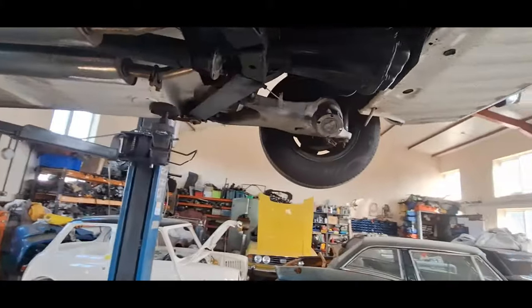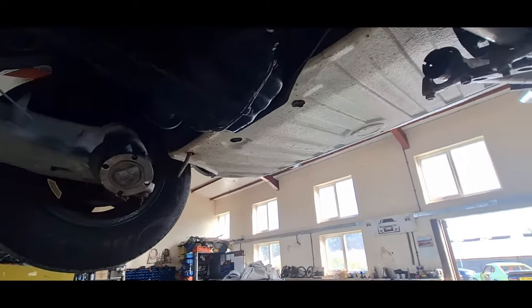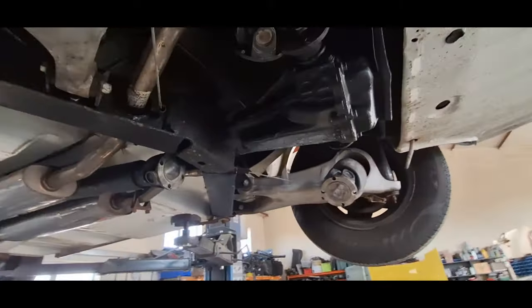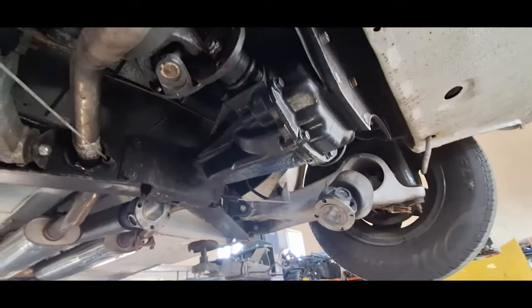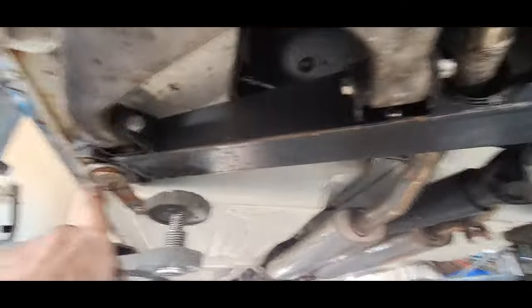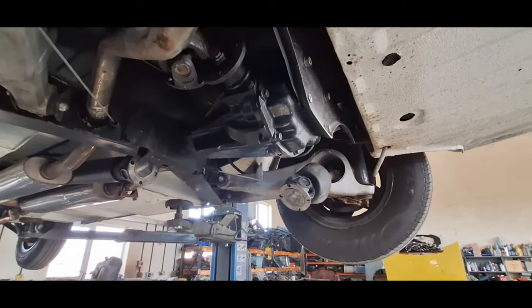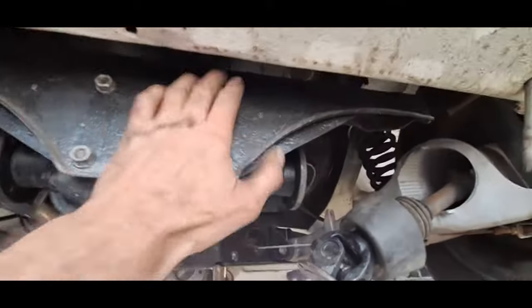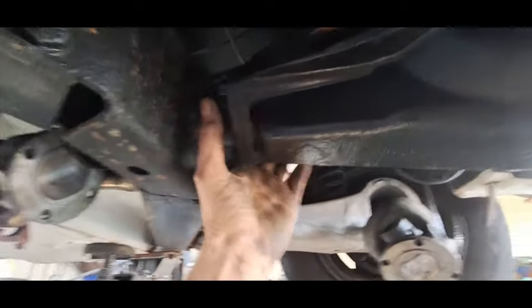If you saw the end of that video, I may have faux-pa'd slightly there and didn't expect it to go quite as quickly as it did. I was going to put the transmission jack under it and figured I probably didn't need it - and yeah, it really went. So it flicked it down. It can't go all the way down because it's attached to these and these can only move on the bushings at the end. It made me jump a little bit and I may need to burn my underwear when I get home. Next I'm going to whip these off, then take off the quill shaft bolts and slide that diff out.